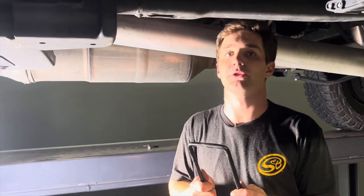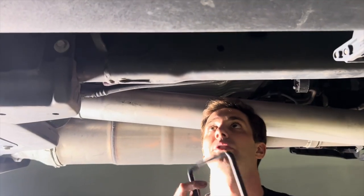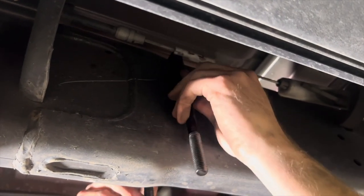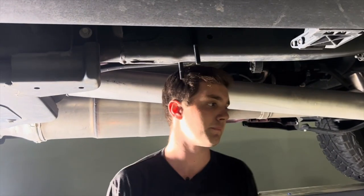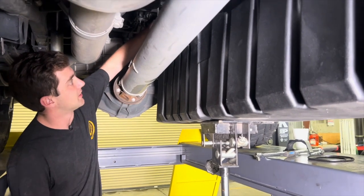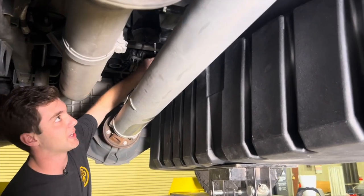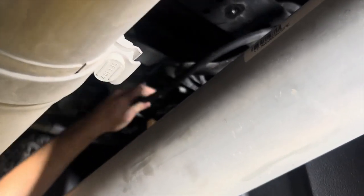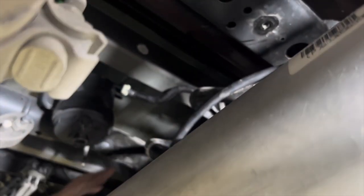Next, slide the U-bolt for the front mounting support over the frame rail — it's going to be about 12 inches behind the DEF tank, which coincides with a bump on this truck's frame. Make sure it has plenty of clearance around your fuel and brake lines. There's also a hanger that installs up over here that holds the front of the tank. As we raise the fuel tank, make sure the filler neck goes over the rear crossmember, along with the rear rollover vent line and the front rollover vent line — route those up and out with the fill level vent.